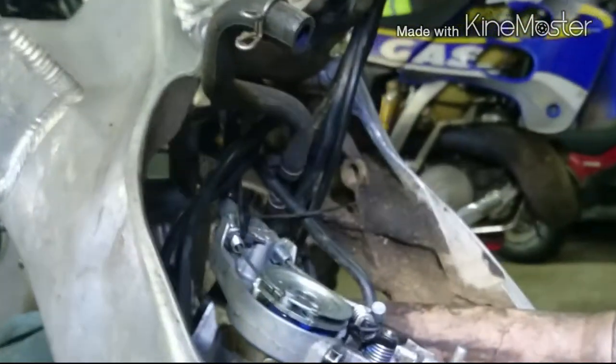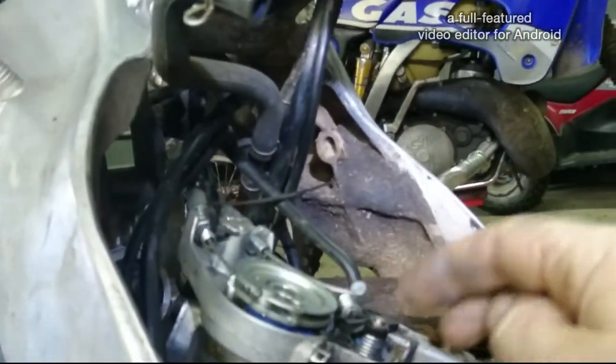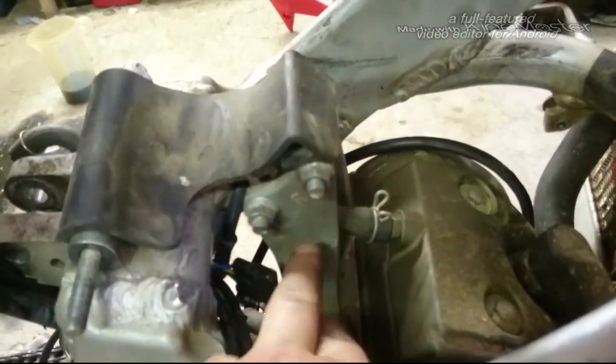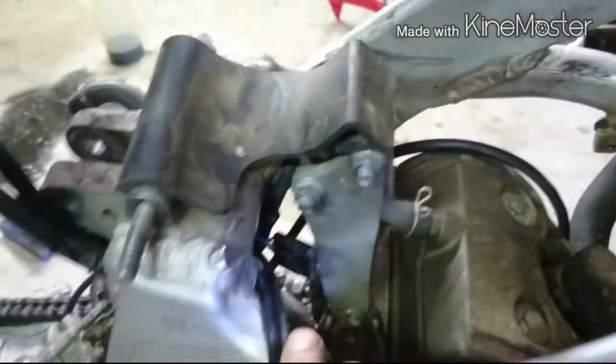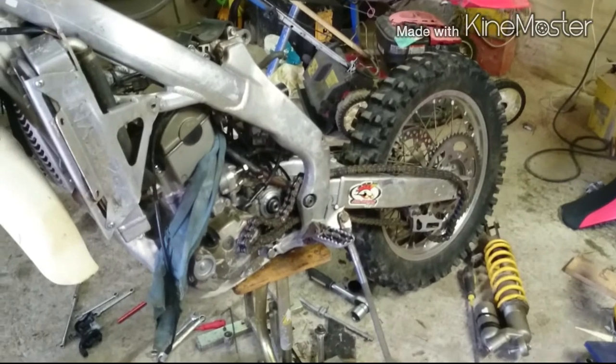And I know there was something else I was spotting here now. Oh yeah, the throttle position sensor wire, it's a wire coming in there, and that's going through. There it is coming out there, come around the bike. It's coming out at the right hand side of the engine mount. See, it's coming out there now, as opposed to in case you put it in through the other side, because it could be anywhere when you start putting back in that carburettor, like Bob Marley with all the dreadlocks hanging off it.